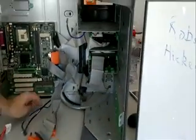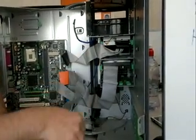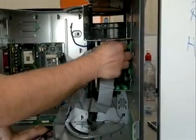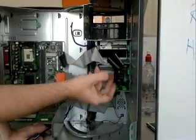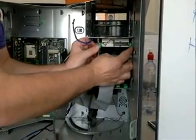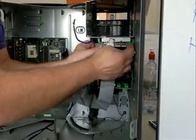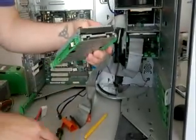Number nine, our floppy drive. We've already taken the power supply out, so we just need to remove our data cable. This black plastic tab — you pull on it and it comes down. Exactly the same as our DVD player — pinch those levers and it slides out. That's our floppy drive.